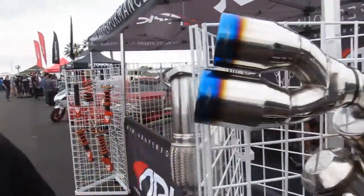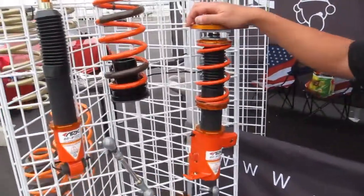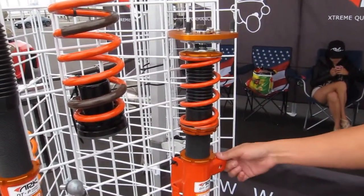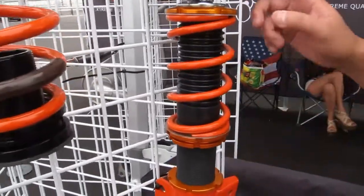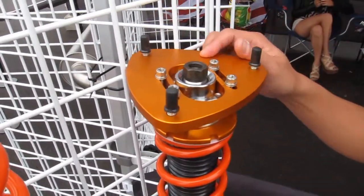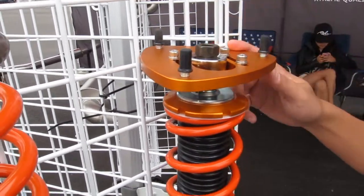Your company also makes and sells some shocks, so let's talk about that. We have two types of coilover systems that we offer. The system on display here is the DTPs. The DTPs are actually for the BRZ — they come with a pillow ball mount, inverted mono tube, and we also have camber adjustment and caster adjustment on our system.